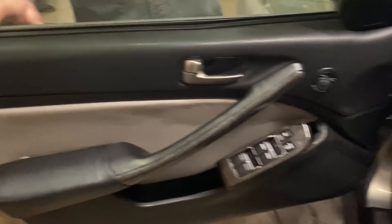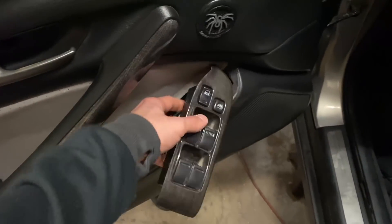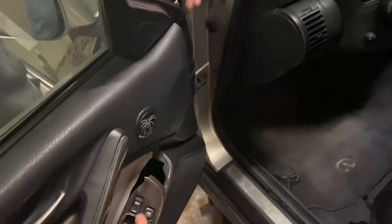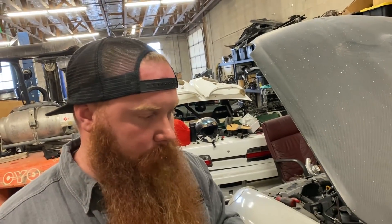The door is swapped over. The windows are having a little bit of an issue — this control panel right here may have already been bad, but it's not controlling the front windows. We'll get a new one and swap that out. That's another problem we're finding — must be a common issue on these, as they always seem to be broken. We'll just have to keep playing around and trying our luck with junk ones or buy one off eBay.